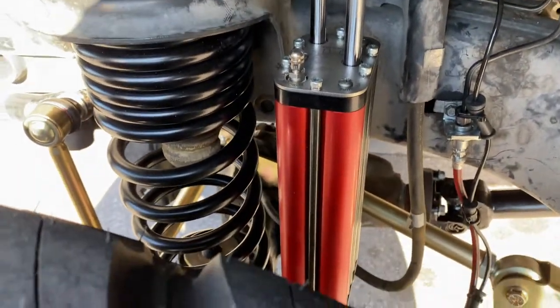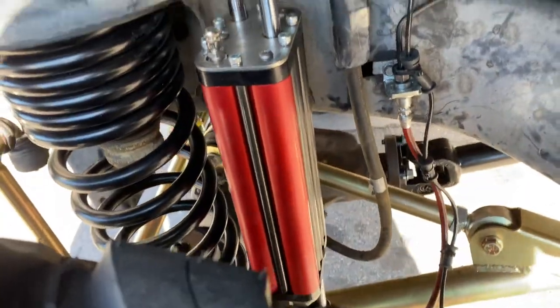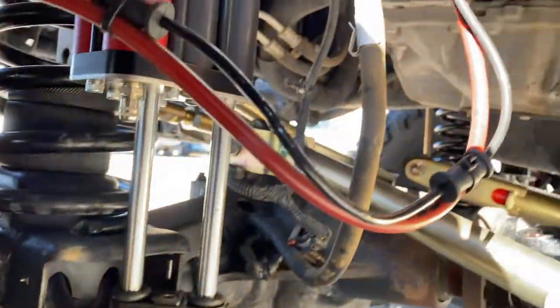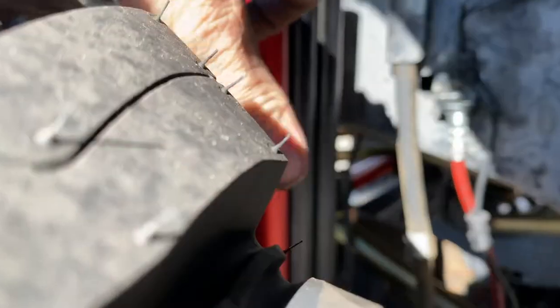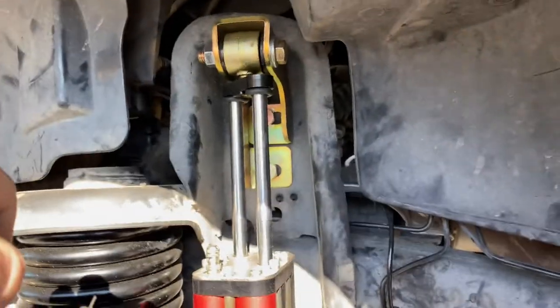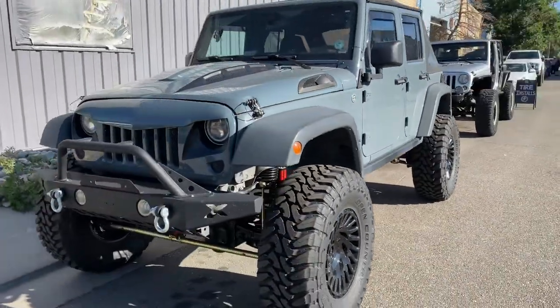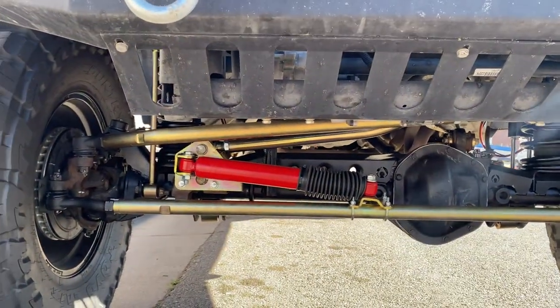You can see their progressive rate spring, their bump stops, and zinc-coated everything. The six-pack shock has two shafts on the bottom and two shafts on top. What that allows is they can actually make the body of the shock smaller and still give maximum droop travel — it'll actually extend longer than most standard shocks with a smaller compressed rate, which is super cool.